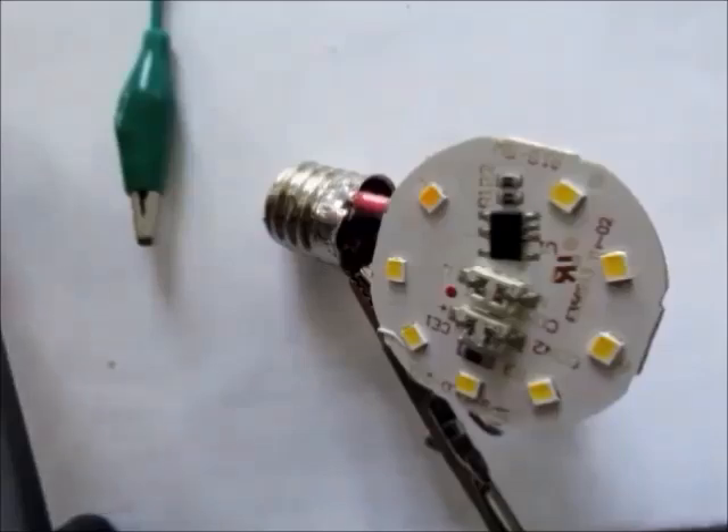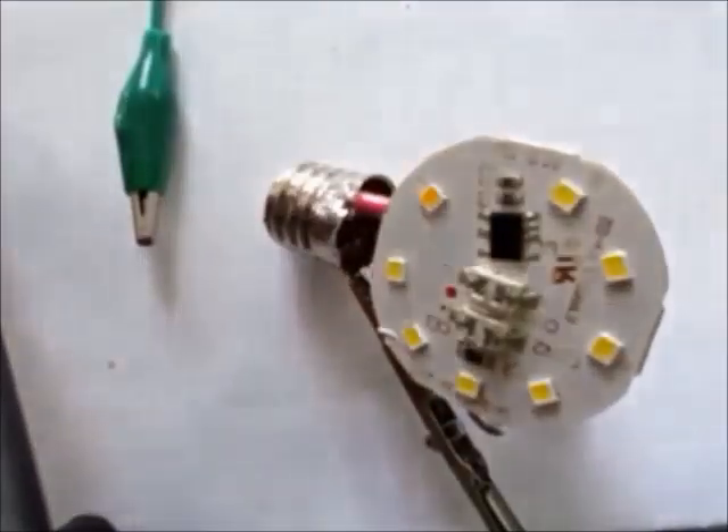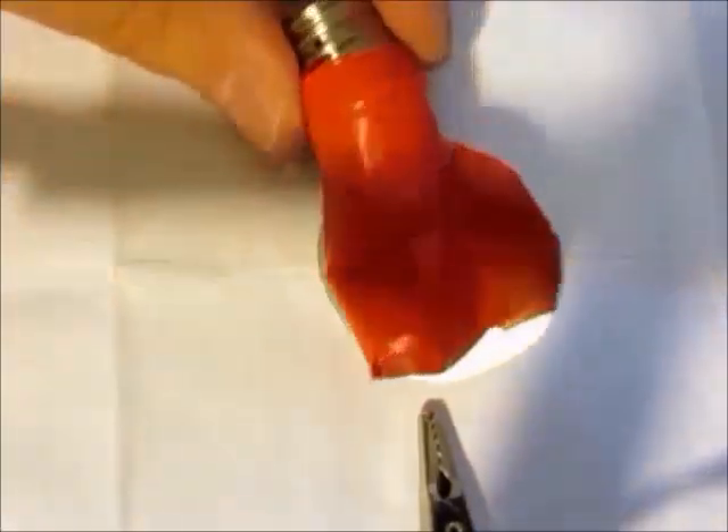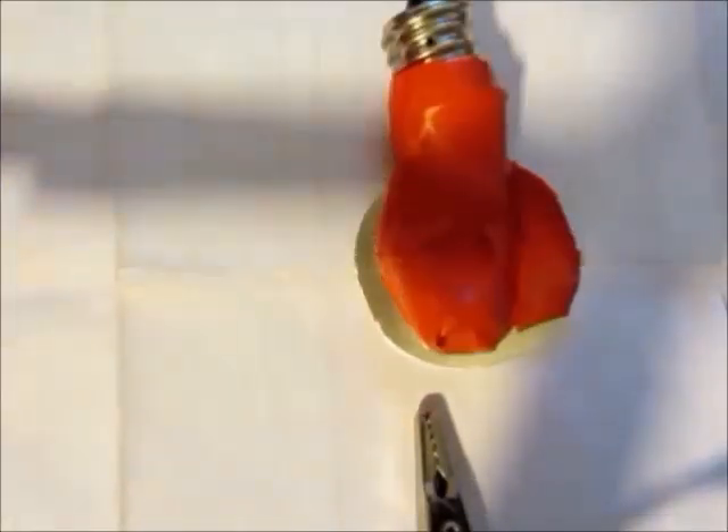I will encase that in some kind of — I'll use tape and maybe some epoxy to insulate it, except for the actual lighting part, which I don't need to insulate. Here I've applied epoxy to hold everything together, and then I'll cover it with a layer of electrical tape as the previous one had. I'll have to wait for the epoxy to dry first. So here we have the finished product, ready to be taped up. Here's the illuminating part — this will just screw right into the socket in the refrigerator and will work, giving lots of light. It will probably outlive the refrigerator.